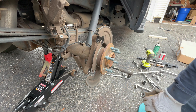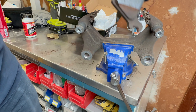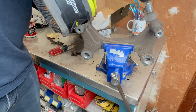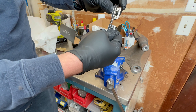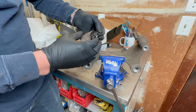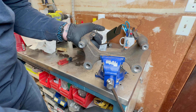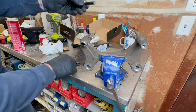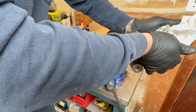Back in the workshop, let's get these old rear pads out. These are shaped quite a bit different from the front ones, and the spring clips are different too. Use a flathead screwdriver to wedge into the slot and work them off. Put a little bit of lube on the bracket, install the new clips — you want the portion with the two holes up top — hook the bottom in first and then roll it up onto it. Both rear slides feel really good and are in a lot better shape than the front ones.